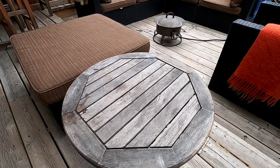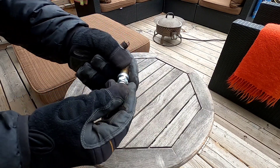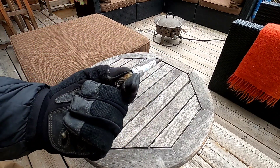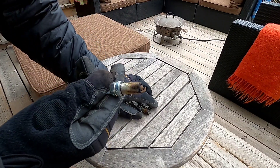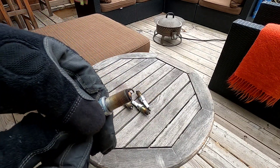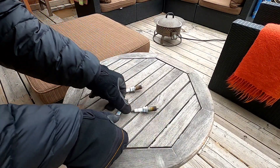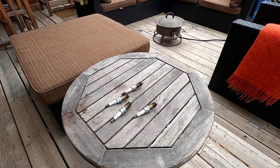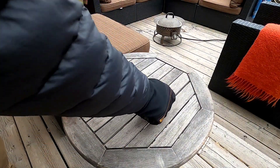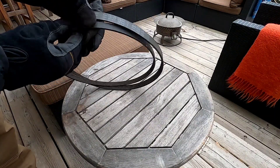Another important piece - the spark plugs. These are NGK ILFR6A, came out of a Subaru Forester XT SH model. They look pretty good - these had 90,000 kilometers on them and they all look fairly similar. You can't say any cylinders are having issues based on those, which is also a good thing.